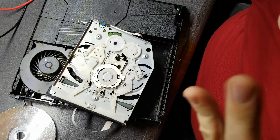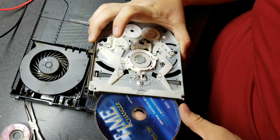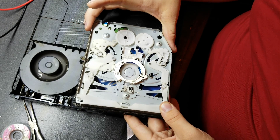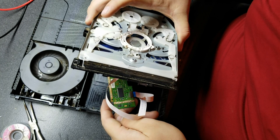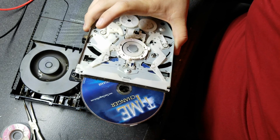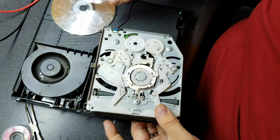Let's clean it up and hook it into the PlayStation. Moment of truth — I've got the disc drive back together and we're going to go ahead and put a disc in and see if the PlayStation turns on and pulls the disc in. It's working! Awesome. Now does the eject work? Disc eject works — yes! So we changed that one fuse and that was it. Just that one tiny fuse stopped the whole disc drive from being able to actually eject the disc. That's awesome.